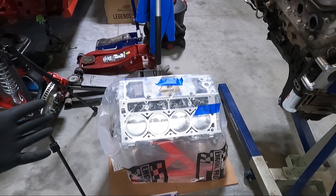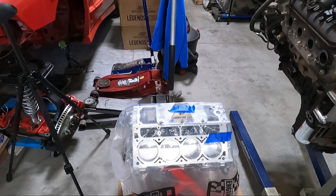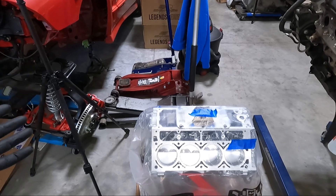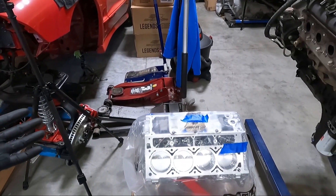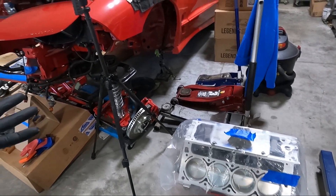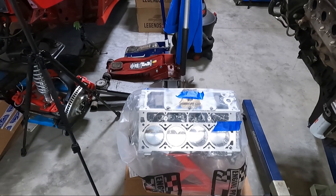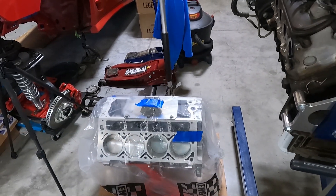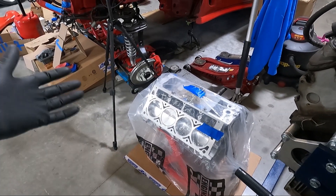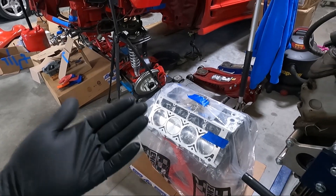So that is what we've got — we got this thing back from the machine shop. Now it's got a set of forged pistons. There's not a lot of rod selection out there, I don't know if it's COVID or whatever, but we went with a newer set of gen four rods, way stronger than the originals. I'm not planning on setting the world on fire with this car, but I wanted something stronger. I also wanted a better camshaft more spec'd for a turbo setup. I ordered another cam from GP Tuning — for the last 10 cams I've bought, he has been the guy. The factory piston has been replaced with a plus-five CC piston, so we're five up from the factory compression.